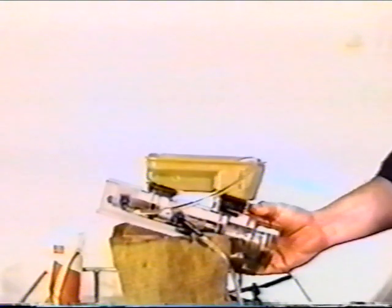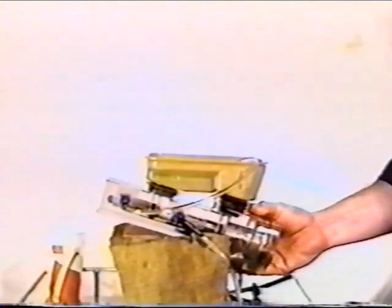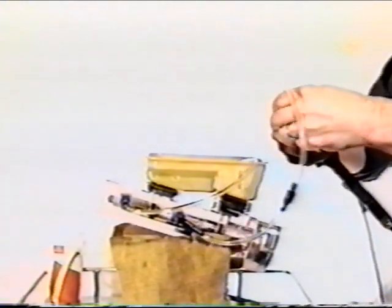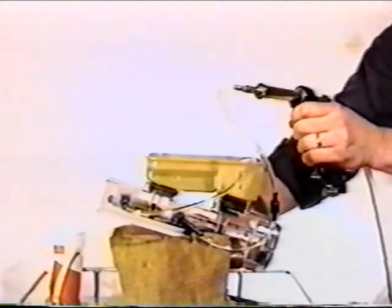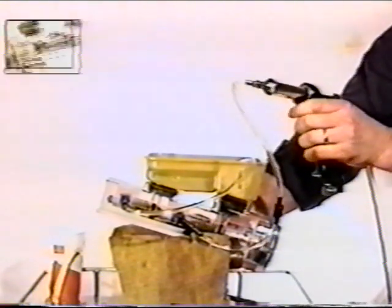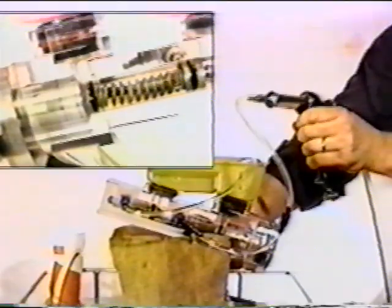For bleeding the primary side of the master cylinder, move the master cylinder body to an angled position in the vise, or the top of the reservoir level. Now, prepare tool for RFI bleeding. Attach the output of the tool to the primary bleeder kit adapter. Leave the piston in its rest position. While using slow, steady strokes, bleed the primary side of the master cylinder.